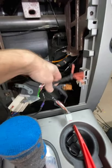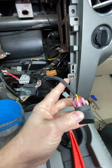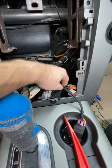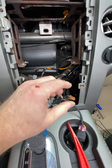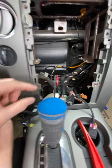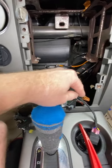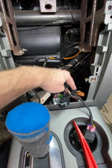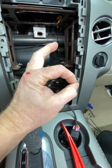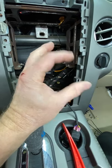So naturally we got it and we're like, this is wrong. What you want to do is add a relay, because a relay allows you to take that constant 12 volts wire that would feed this and switch it on and off with a secondary source. So we still use the red here, the ignition. We just added the relay in to interrupt this. Normally it'd be one piece of wire, but the relay allows us to turn it on, turn it off, back and forth.